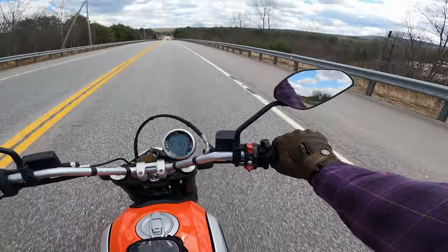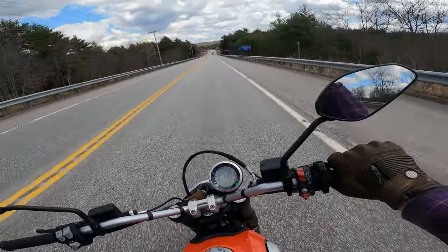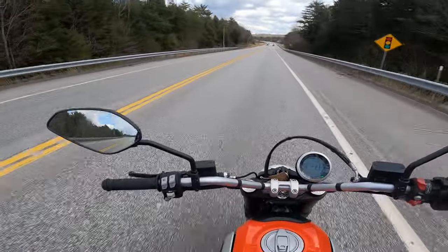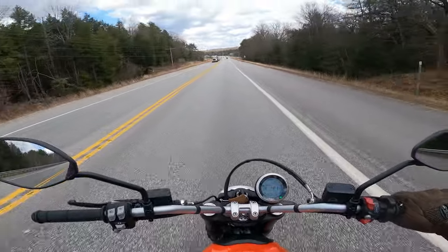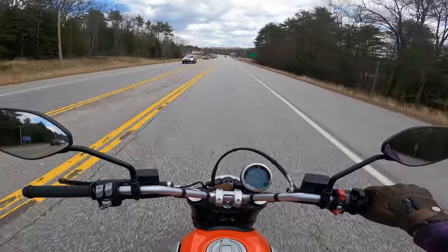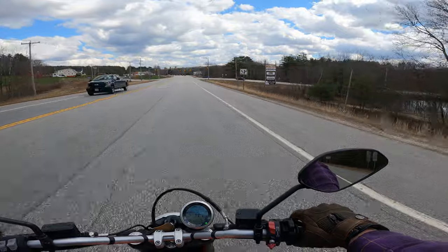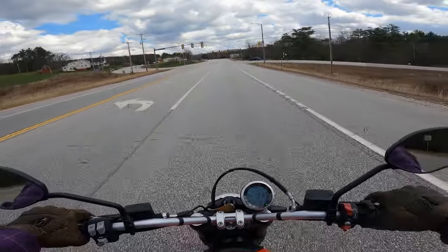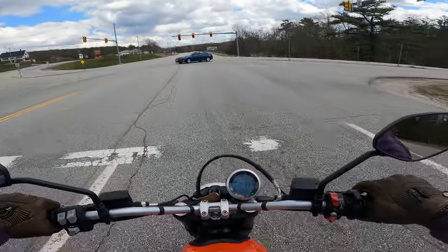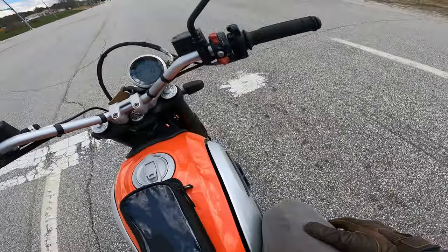It's a fun little bike through twisty roads because it's just so light and easy to flick around. It really doesn't take a lot to get the bike to countersteer — it just wants to drop right in. Some of that comes down to the tires and profiles, but the lightness of the bike and the engine design give it a lower center of gravity than other bikes. Being an L-twin, you have half the engine laying right along the bottom of the frame, giving you a nice low center of gravity — a very very stable platform, and it's definitely noticeable.